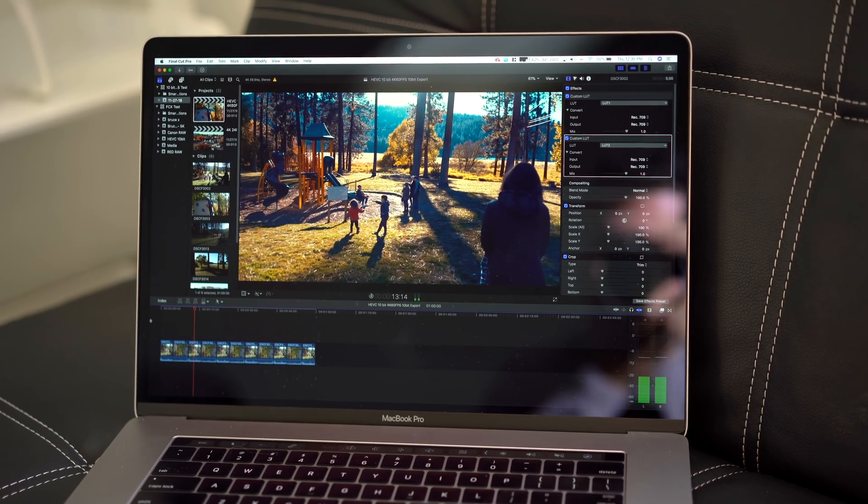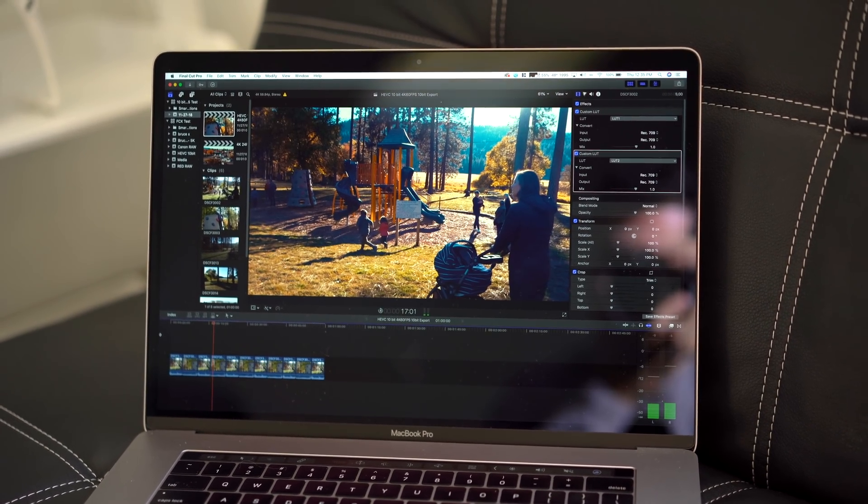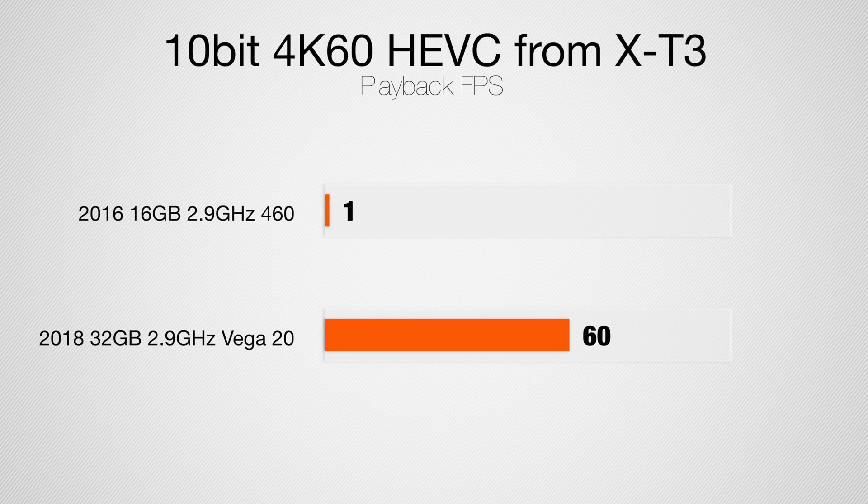I had a very hard time figuring out which one it's using — is it using the T2, is it using the Intel decoding? What the T2 chip is actually capable of? I did a ton of research but couldn't find out what is being used. Now where we see an even bigger difference is if you're working with 10-bit footage. If you have an older machine — a 2016 or a 2017 — it is extremely difficult. I'm getting about 1 frame per second instead of 60. It just falls apart and my computer is crashing.